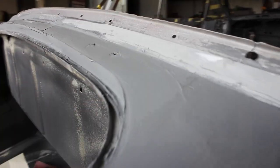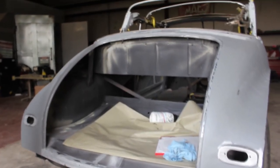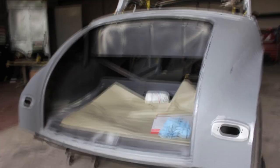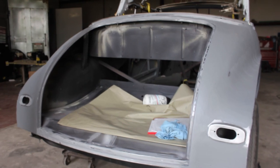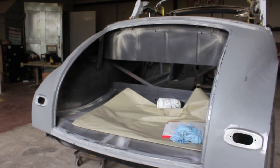It's the foundation of all the body work. The reason this is going on is old 48 Chevys — and a lot of Chevys, 30s and 40s cars — were all done with lead down through here, where the hinges are, all around here, all the inside areas. The reason they used lead: that was a metal-compatible product back then that didn't shrink, moved with the metal, and that's what this epoxy will do. It's a lot stronger than regular body putty. It's over five hundred dollars just for a quart, but it is a high grade binder with great resistance. It's everything I'm using to replace lead.